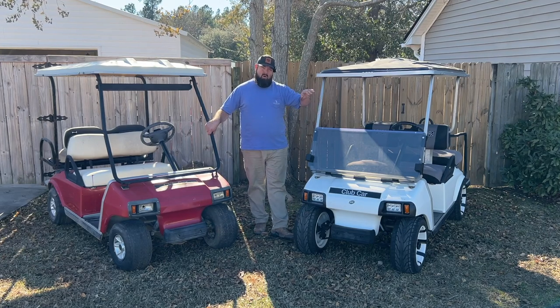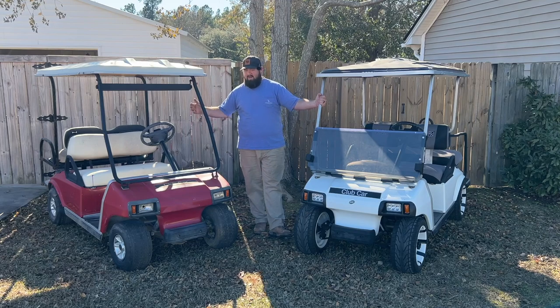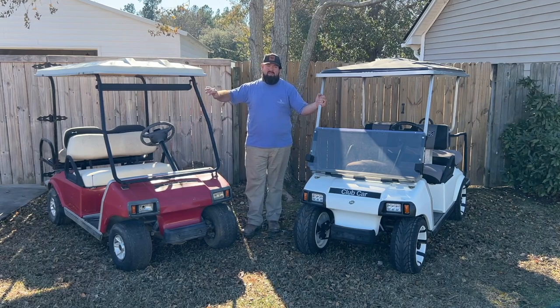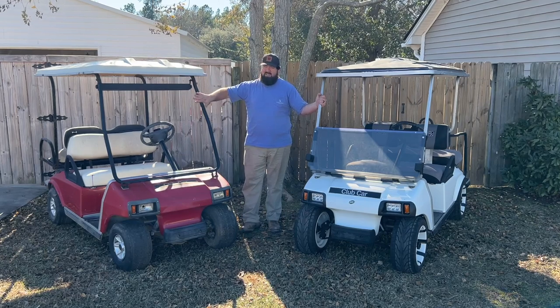The series golf cart here, that's on my left, your right, was designed for torque. It's very easy to make torque with these golf carts, whereas the Sepex golf cart here is pretty much like a people mover cart. A lot of the newer golf carts now have gone to the separately excited motor systems, or Sepex, and this is the golf cart here.